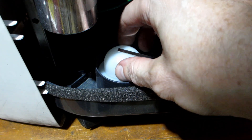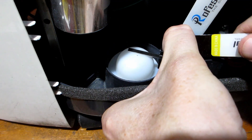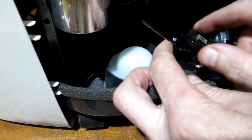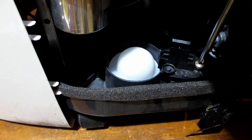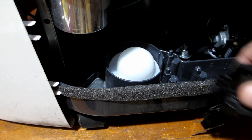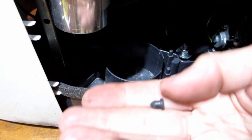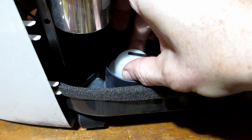That's when I noticed the float was crooked — it's like there's something underneath it. I spudged the switch because the wires were too hard to unplug. The bracket hangs over the float so you have to pull that out as well. I yanked the float and sure enough there's some rubber plug under there. I don't know if it fell down from above or what.